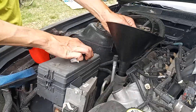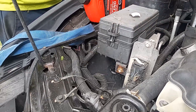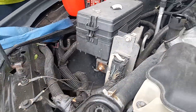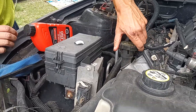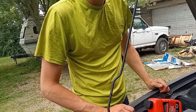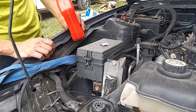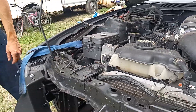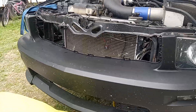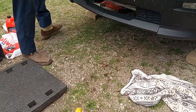Check the funnel. If you've got a rag, use it to clean down in there. Put your oil cap back on. Now that is how you do an oil change. He's going to check the oil too. You want to remove the jack stands and lower the car back down to a level surface to check the oil. Make sure you pull all your stuff out of there and don't forget the oil pan underneath — the container you drained your oil into — before you let the car back down.